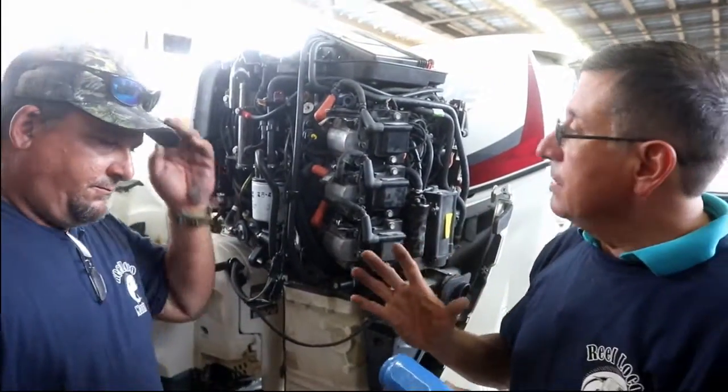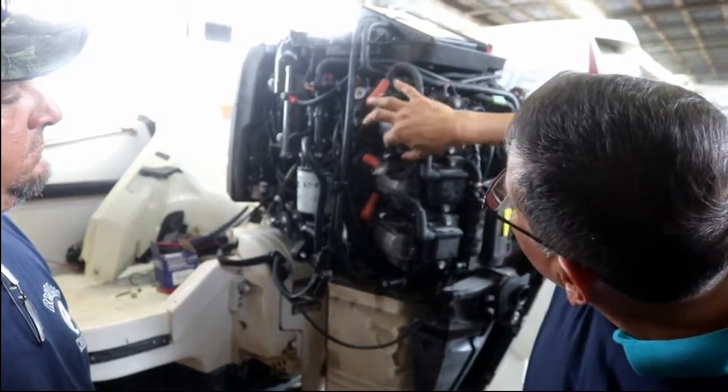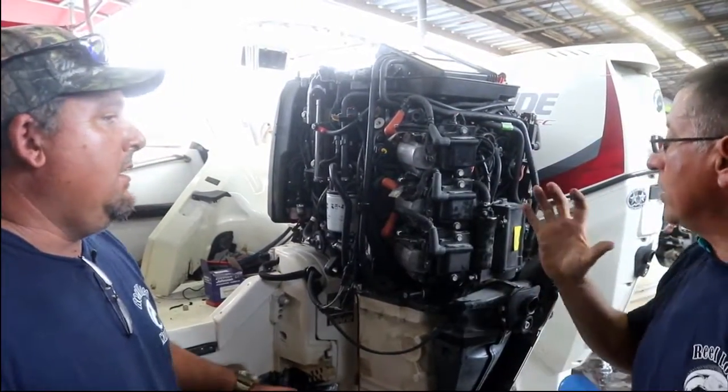All right. Perfect. We have 55 volts on the injectors. And yes, when we remove the plugs, we can verify with the multimeter the 55 volts, intermittent, depending on the signal from the computer. Yeah. All right, perfect.